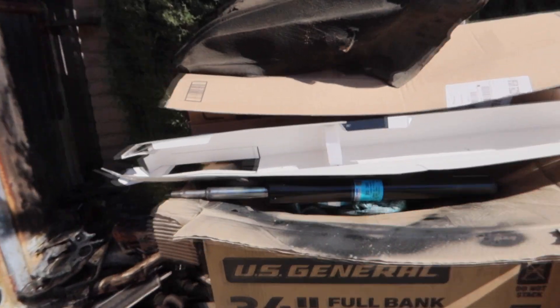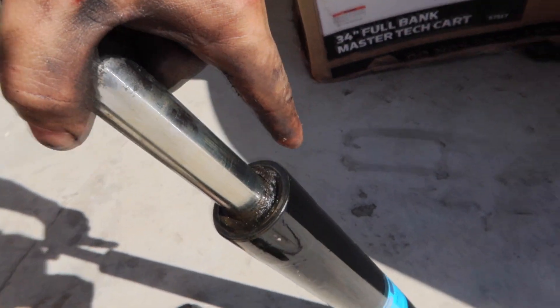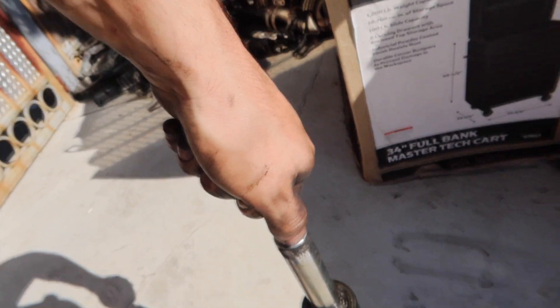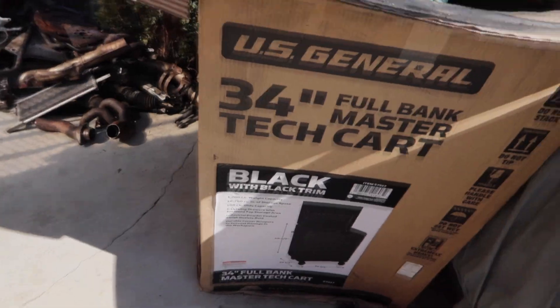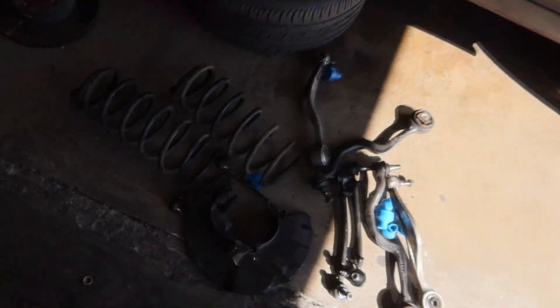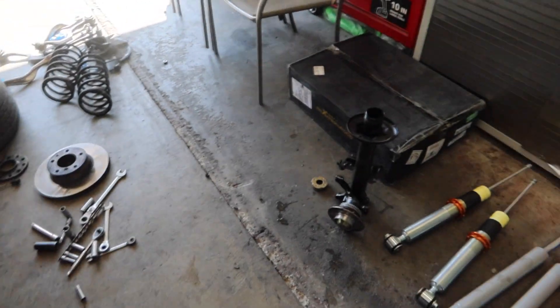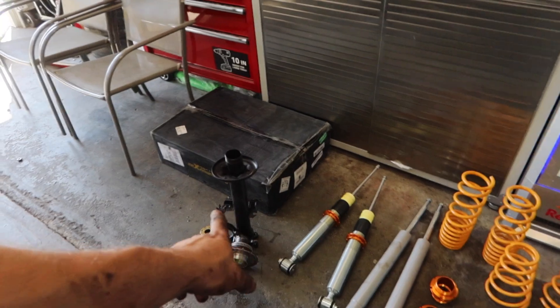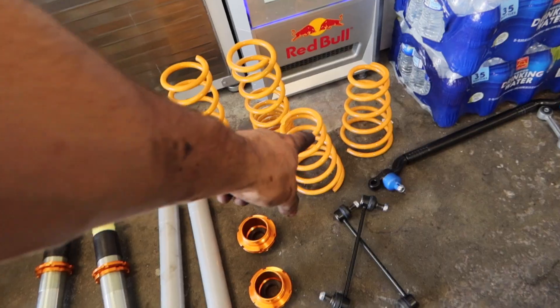Here's one of the old shocks — this is how bad it is. All the oil is leaking all around it, and if you push it down with your hand and it doesn't come back up, that's how you know it's really bad. Those shocks were completely toast. I actually cut the brake shield off because it was getting in the way and it was also loose — the driver's side was already off anyway, so we just went ahead and cut it off. My next step is to put together the coilovers — putting these new shocks into the old strut housings.